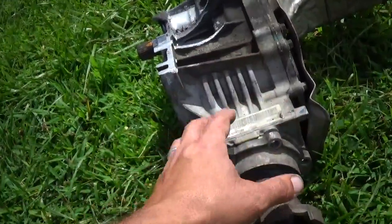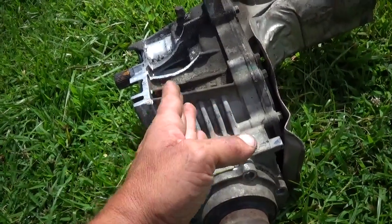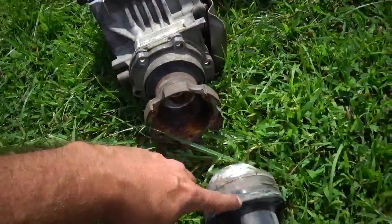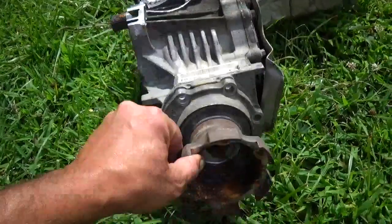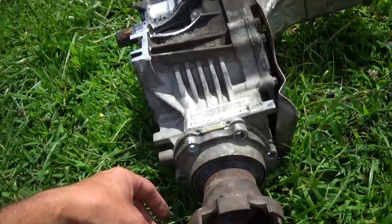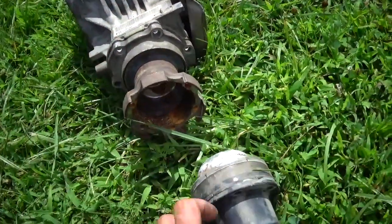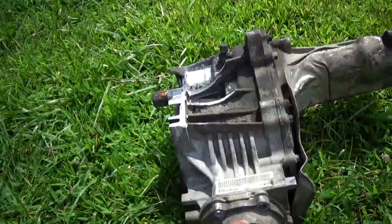I've had this off and taken it off here. Basically what I'm seeing is it's just two 45-degree gears in here. I can't see any reason why it would damage this with the rear end unhooked — if anything it's going to be easier on this piece to not be driving it. From what I could see pulling this off and seeing what's inside, I just don't see how it would cause any harm. So I think you could drive around indefinitely leaving this in without having the rear end on.